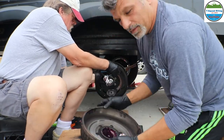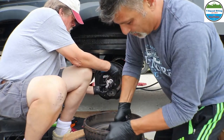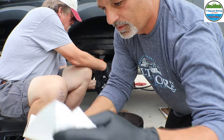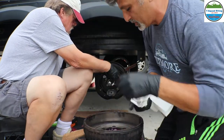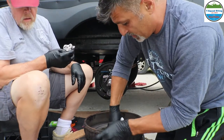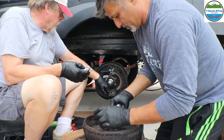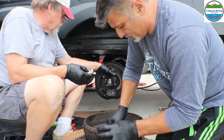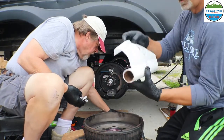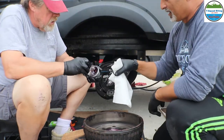Also, making sure that the drum is completely clean on the inside. That gets rid of all the grease. You can see we're going to put all new grease in there. Actually, we're not putting grease in the drum, we're putting grease in the bearings, and they drop inside here. You don't have to pump that much grease in there. When you pump it in here, it'll go into the bearing chamber, and that's fine. But I think this is a little excessive. That is crazy.